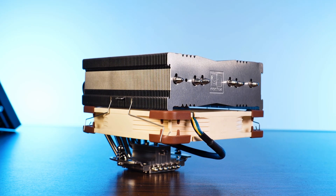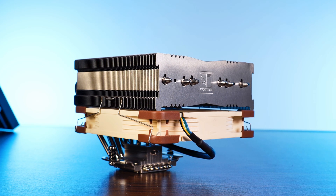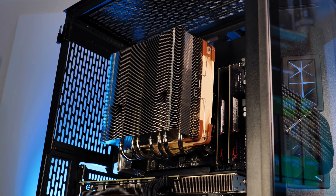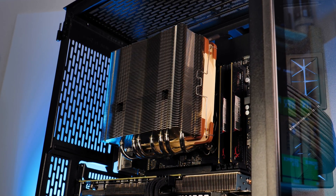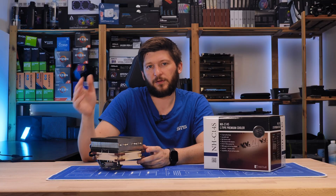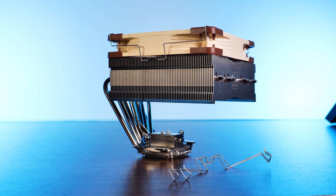However, there is also something called low-profile mode, meant for people that really want to use this monster of a cooler but can't afford the height. In this case, we can take the A14 and install it underneath the heatsink. This lowers the overall height of the cooler down to just 115mm, but simultaneously lowers the maximum RAM height down to 40mm. This is not a total deal-breaker — things like Corsair Vengeance without a big heatsink on top will fit perfectly fine. But if you get into the RGB space, like Trident Z's which are 44mm, that's a bit too much. And then there's also a dual fan mode, basically designed for the madman out there, but that's for another video.